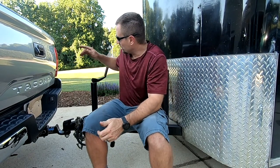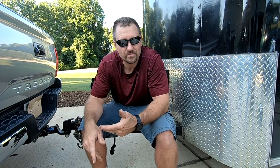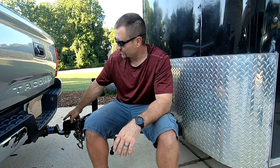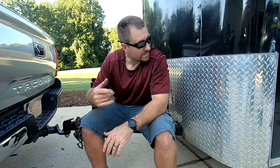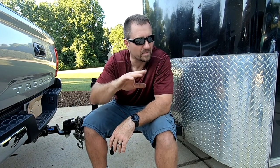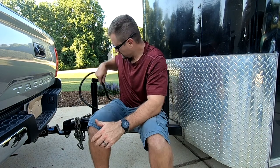While we're up front, inspect the trailer jack. A lot of these trailers have the jack protruding down to reduce cranking. The problem is when you go over bumps or railroad tracks with a low truck — and this trailer sits pretty low — if the jack is too low it can drag. Also try to keep the trailer as level as possible: too much tongue weight or having it jacked up in the air can cause fish-tailing, especially without trailer brakes.